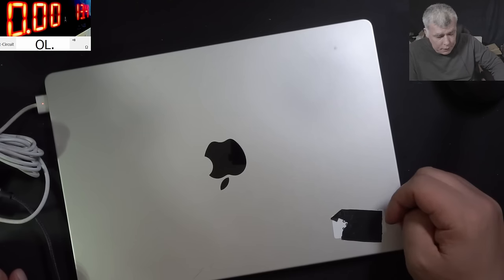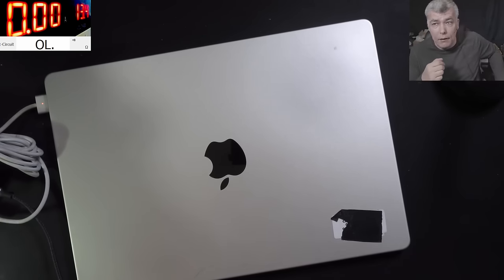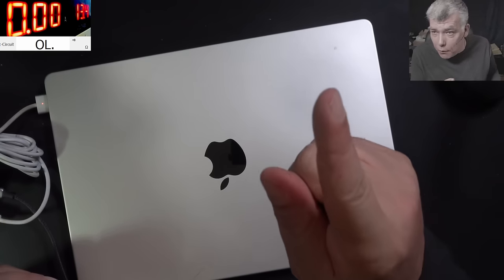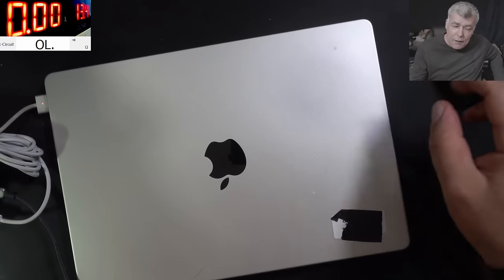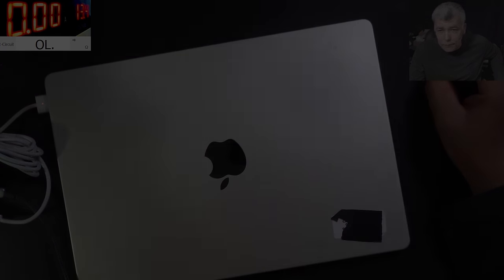I'm happy, I hope the customer is too. Now, if you try to replace the capacitor yourself — there was a burned board layer, and it can go bad again and burn more. The capacitor was drawing excess current and getting hot. Anyway, if you take a laptop like this for repair, just taking the screws and everything out and putting it back takes about one hour — that's crazy, insane. So I'm going to stop here. Thank you for watching — subscribe if you like the video and see you on the next one. Bye.